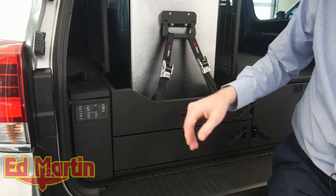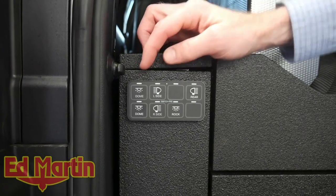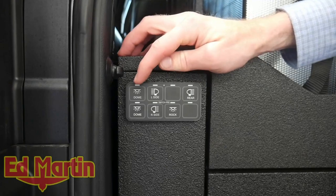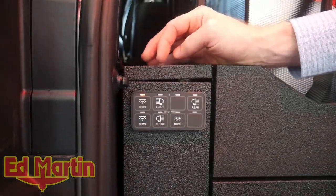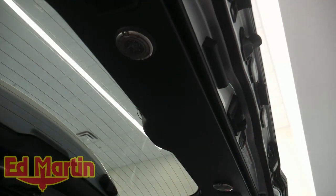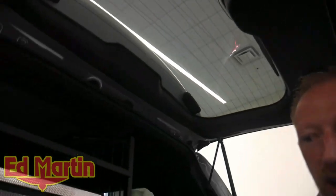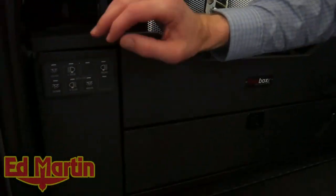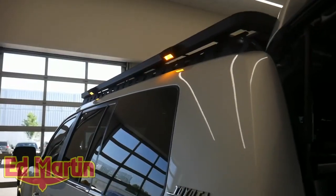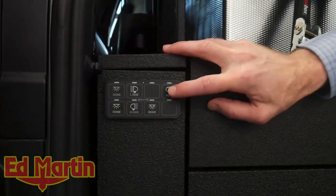What makes this electrical setup kind of cool is we have two Switch Pros in this vehicle — one's in the front, one's in the rear. They are daisy-chained; they talk to each other. There are a couple switches that are three-way. Right now we have the dome switch, which is going to turn on the drawer lights in amber or red. You can shut it off here and change it to white. We're controlling that from the actual Switch Pro mounted to the left of the TrekBox. We also have left and right scene lights and the reverse lights.